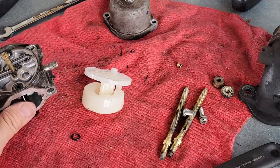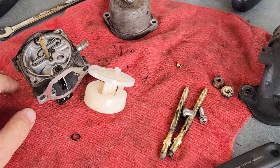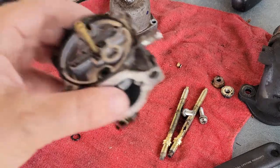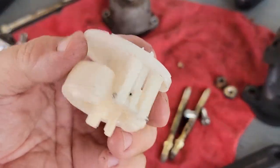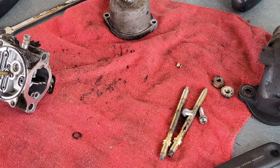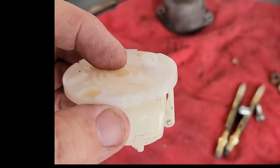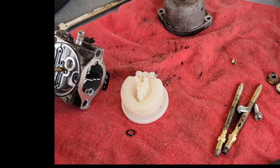Make sure you drain the gas and oil out — you can make a mess doing that. If you let the gas thin out your oil, it won't have the viscosity it's supposed to have and it will cause your engine to burn up. The float needle and seat goes up and down and shuts the fuel off, but if that o-ring fails, you're going to have gas in your oil. Thanks for watching Fixing with a Kid!